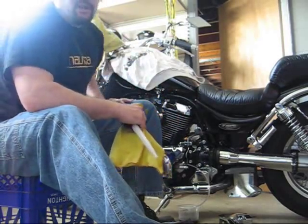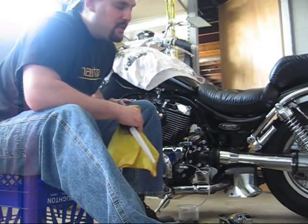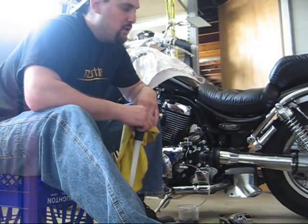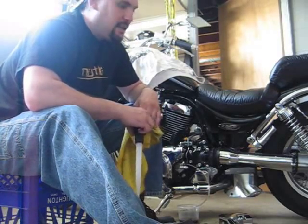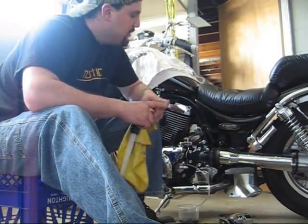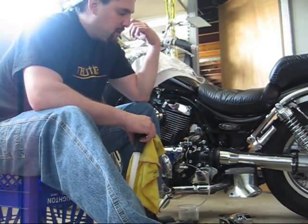You're going to want to make sure that you're not pulling back any levers. You don't want to pull back the clutch lever at all while the cylinder is open and empty. Make sure you put clean fluid in the cylinder before you do any pulling back of the levers. That goes for the clutch or the brake, obviously. You don't want to get any air into the line. Once you've got it depleted, again, fill it with clean fluid.